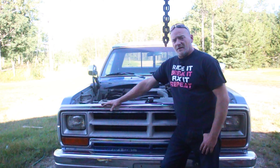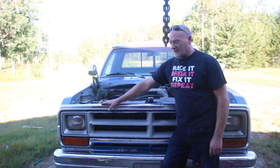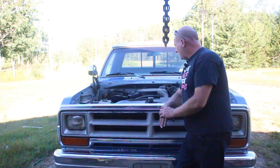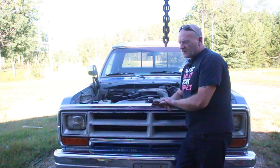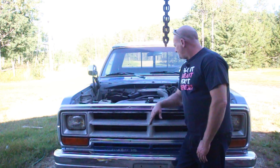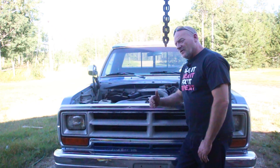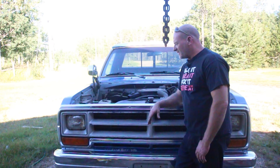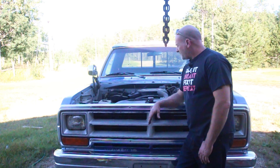This was the first truck that I did an EFI delete on. It had that wonderful late '80s EFI throttle body injection that didn't work worth a dang. The engine I put in here is a 360 with a stage two RV cam — around 440 lift, about 225 duration at 50 thou. I put Magnum Dodge heads on it from a 360 or 318, late '90s. After that we essentially just drove it, but this engine has had an inherent issue.